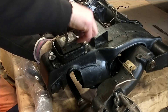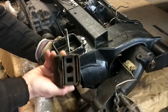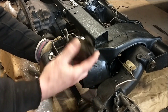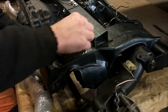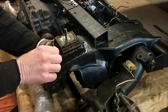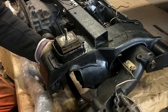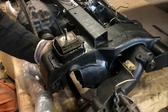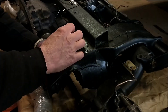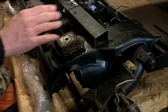So this is my solution, because as I said this design is totally ridiculous. There's no use trying to glue it again — it's never going to work. And buying a new one won't help either, even if it's available, because it's probably the same mount used on something like a Berlingo which doesn't carry this heavy drivetrain. It's going to break anyway, probably sooner rather than later. It's a bad design and they didn't do their homework.